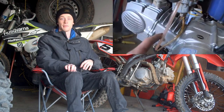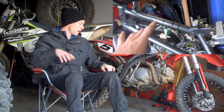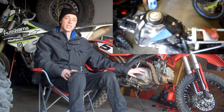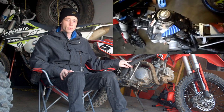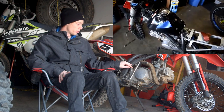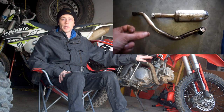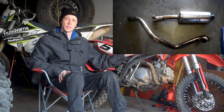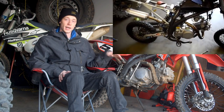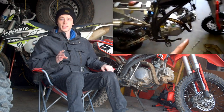If you have any questions about the engine swap, feel free to leave them down in the comments — I'd gladly help you out. It's relatively easy. You can use the same motor oil as before, about a liter of four-stroke motorcycle engine oil. You can use the same carb filter. Make sure you're using the VM24 size carburetor and not the 22 — it's a little too small. You can get away with the VM26 carburetor as well, but whatever carburetor you put on, you'll definitely need to tune it.